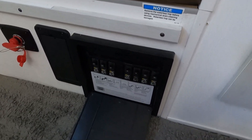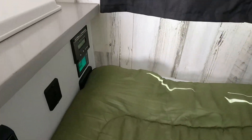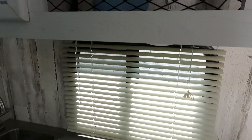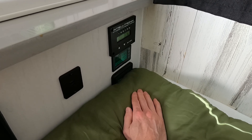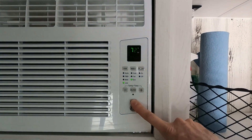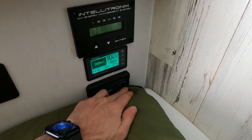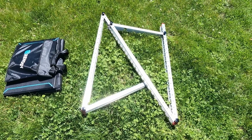I keep this CON switch turned on because we've already removed the converter, and that means I have an extra 120-volt outlet in that cabinet in case I want to use it. One quick thing worth noting: when the inverter is turned off, even though we have shore power plugged in right now, if we try to turn on the air conditioner, nothing's going to happen. The only way the air conditioner will turn on is if we turn the inverter on — even when shore power is plugged in. So, I like to make sure that our inverter is turned off anytime I'm not using the camper.